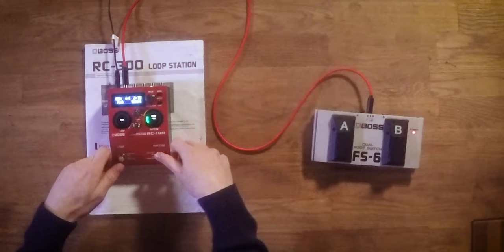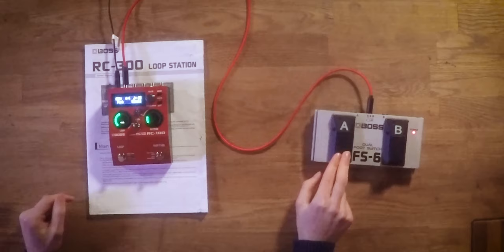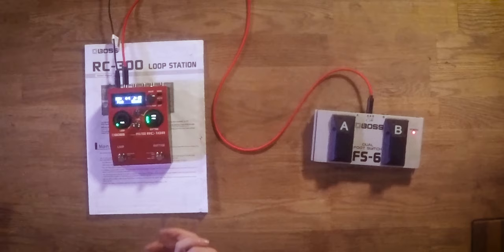What Track 2 Control allows us to do is record, overdub, play, undo, and clear the track — it's literally going to be assigned to our external pedal. We click the dial in to save that and exit out. Now we click Rhythm and Loop in at the same time to switch over to Track 2. We click Foot Switch A to start recording, click it back to start playback, click it again to begin overdubbing, and hold it for two seconds to clear the overdub. We can double-tap to stop the loop, or we use Foot Switch B which we've assigned to stop the loop for us. There we go — that is it working.